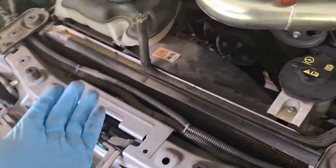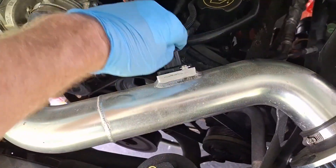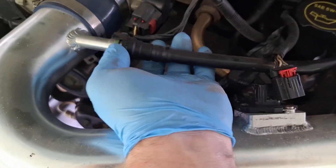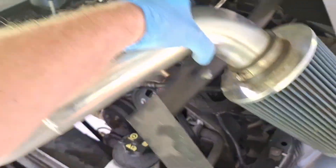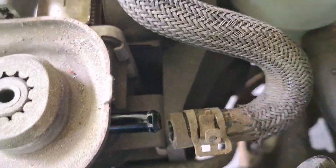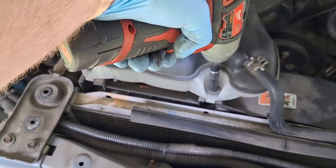I don't think you'll have to pull the radiator out, but I'm going to because I want to replace it — it's 20 years old — and it does help with clearance on pulling the engine out. Next, go ahead and pull this cold air intake off. If you have the factory intake it'll be similar. Overflow hose — get that out of the way.